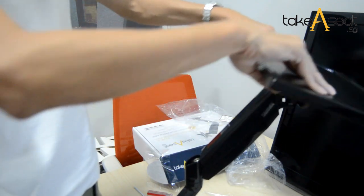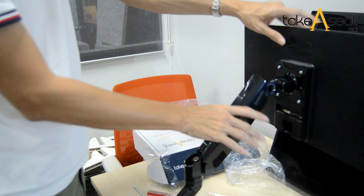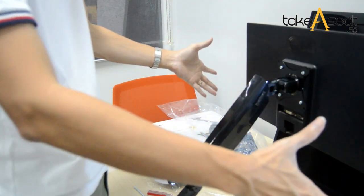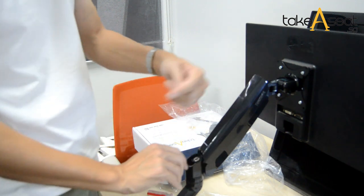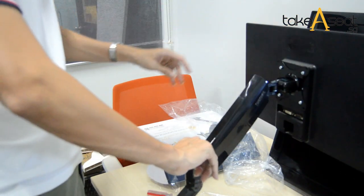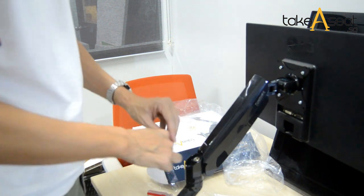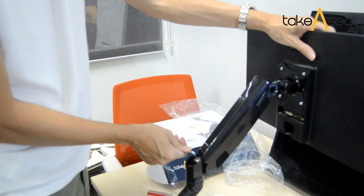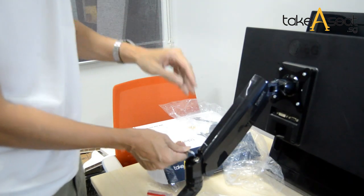You can push it downwards, and if you push it down it will bounce up. The tension is a bit too much — if you have a heavier monitor, you will need stronger tension. So now I need to use this allen key to adjust the tension in the negative direction downwards, so you can have less bounce from the hydraulic. If it immediately bounces back up when pressed, the tension is still too high.